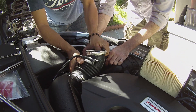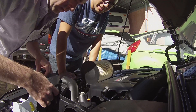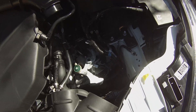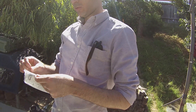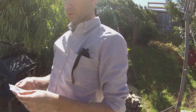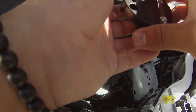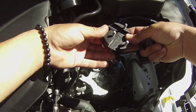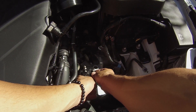We haven't told you what we're doing yet — we are swapping in a short shifter. We're adding the FS Works short shift plate because nobody likes the stock throw. I had this on my ST before and I really like it because it has adjustability: 20, 30, and 40 percent reduction. The way it works, it has a groove slot so it fits in a triangle space, relocating where the shifter mechanism goes.